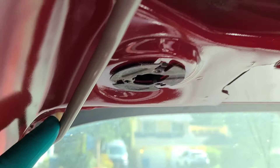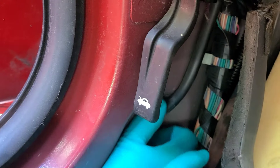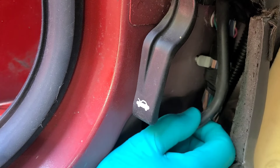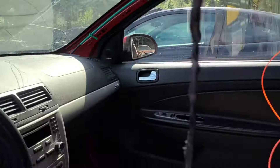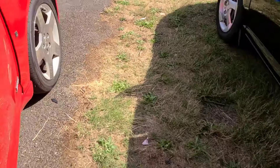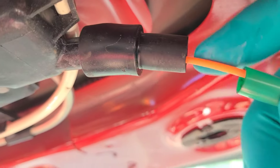Here's the first one on the driver's side. It goes down the driver's side A-pillar, and then it comes out underneath the carpet right here to this hose. This drains into your rocker panel drain holes — and there it is. And there's the passenger side. I can show you what this looks like — there's the weed whacker line.